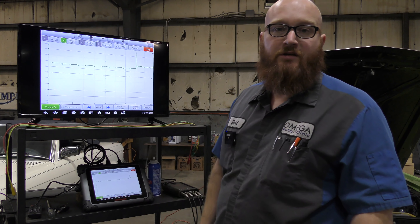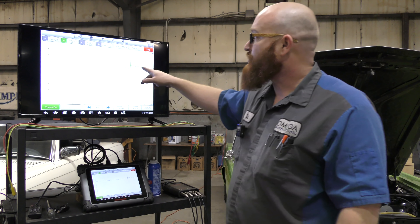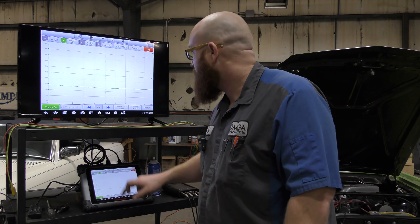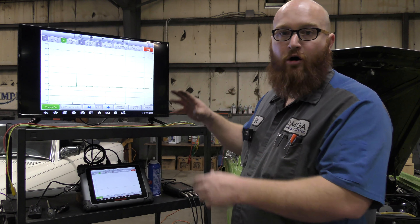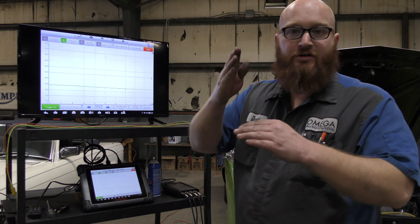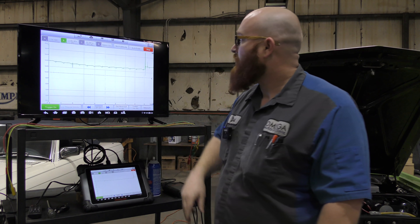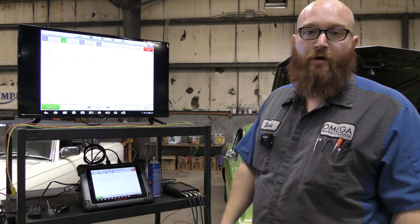This here is what we see as the fuel injector. I have a little pigtail that plugs in line with the fuel injector, and as you can see, each little tick is the firing of the fuel injector. You can change the different settings on here and zoom in or zoom out on the actual signature. If you zoom in between each one of these, you can actually see the kickback of the coil inside the injector firing. So you'll be able to see that it is firing, it is working, it's in sequence — and that way you can know that injector is working. If it was just a flat line or dead, you know nothing's going on there.